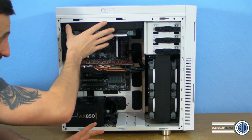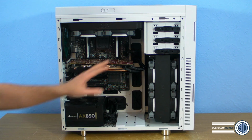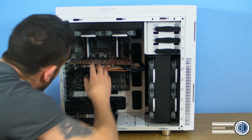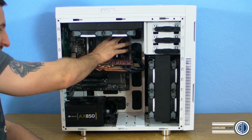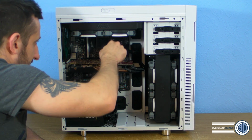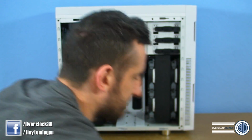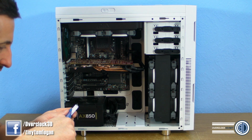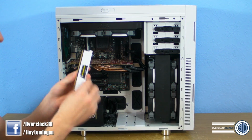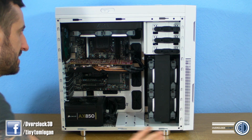Memory: because it's sat over, you can get your RAM in there, okay. Now I'm using Vengeance low profile here, but it's not really mega low profile. I would say I'd try and get it out for you, but I'm never going to be able to get my hand up there to unclip it. Oh, there we go. It's not mega low profile really, and these RAM sticks in total are 31mm tall, and I'd say you could easily have up to about 35mm, from the base of the RAM to the top, and you'd still be able to get a radiator in this okay.